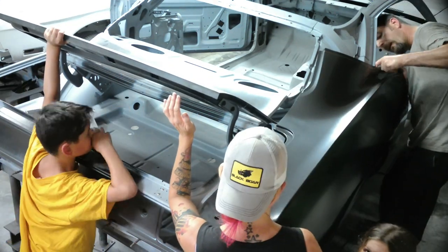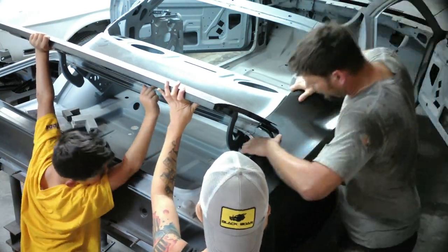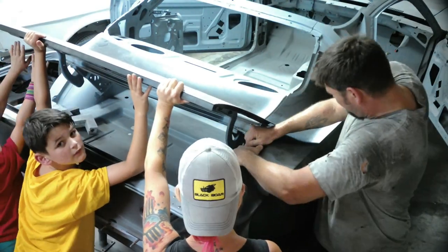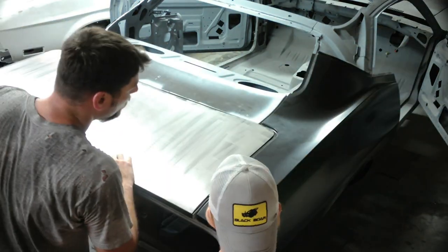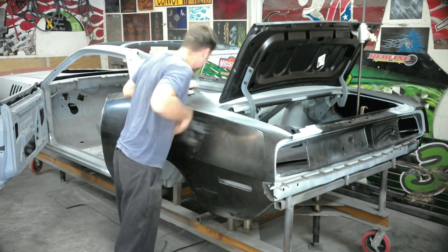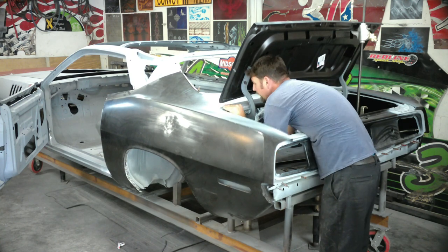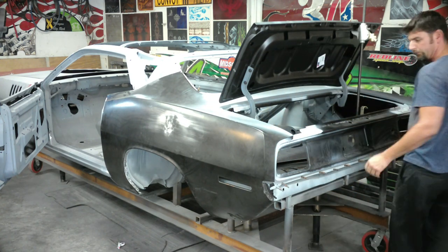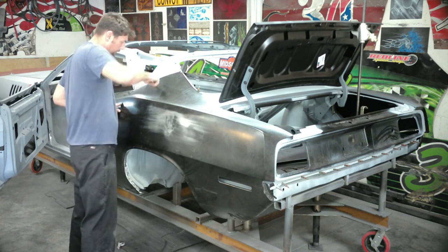The whole family wanted to get involved — the exciting part, the car starts coming back together. There's no metal work done; I'm just straight out of the box seeing how bad they're going to fit and how much work you have to do to them. Don't expect that you're going to take a quarter panel out of the box and it's going to just go on the car perfectly. On the driver's side quarter panel, these are on and off the car probably three or four times at this point. I found that removing the trunk gutters is probably your best bet to install the quarter panel — it makes the panel go on a lot quicker. This quarter panel also has a dent — it came like that, but we went in and it only took about 10 minutes of metal work.